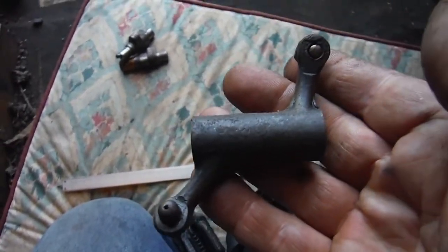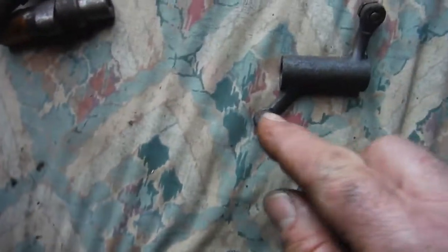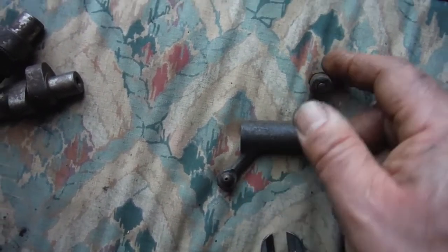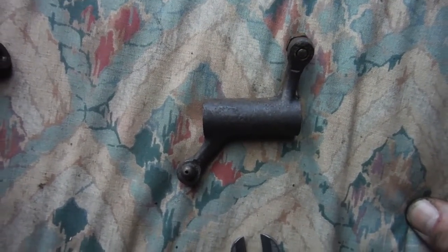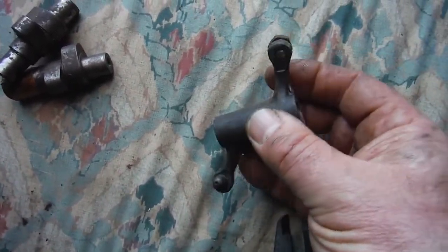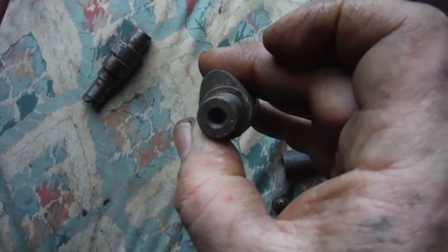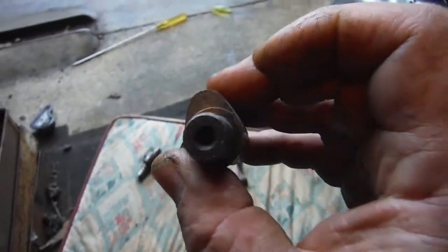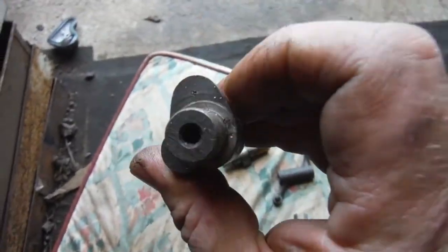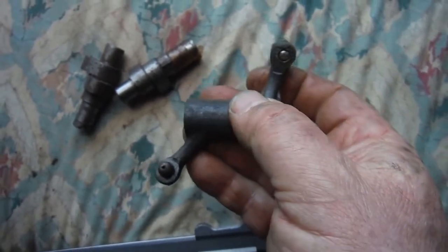Radially there's a lot more reach, so the rocker has what's called a ratio. I would suspect — I haven't measured it — but probably somewhere in the region of 1.2 to 1. So for every millimeter of movement from the cam and push rod, you're going to get around 1.2 times that at the valve. With the standard camshaft, once it's operated the push rod through the rocker, the valve will move more than the lift the cam imparts directly, because it's multiplied slightly. So the lift of the standard cam is magnified to around about the direct lift you'd get off the R cam.